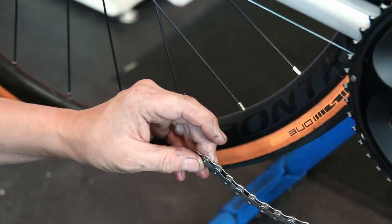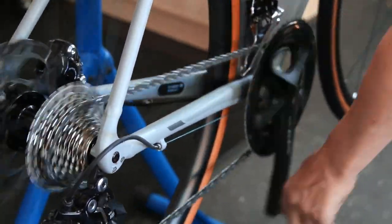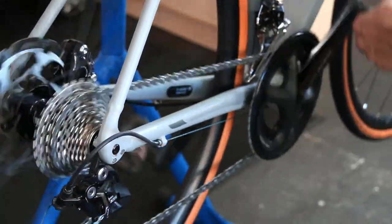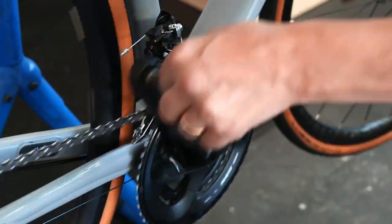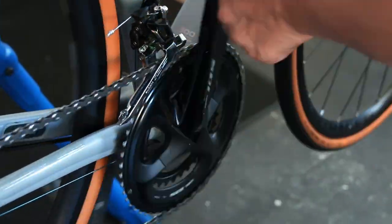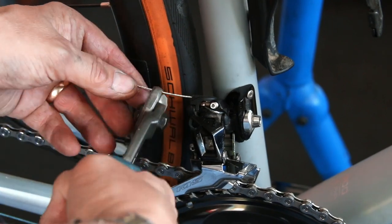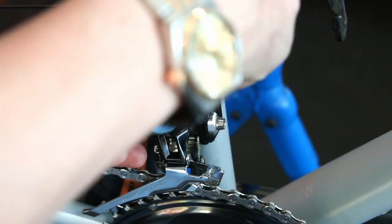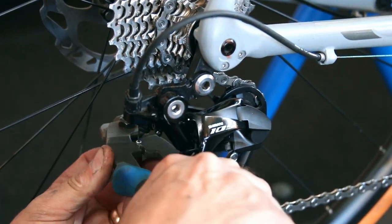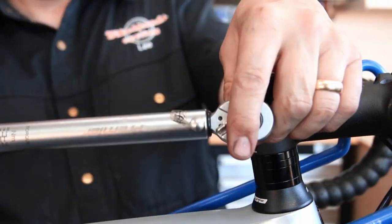Next on goes the chain — sized to the bike with a quick link. Now we begin to adjust the gears: we adjusted the low screw and the B screw, which made a perfect change on the back. Then we had to do quite a bit of adjustment on the front derailleur — it was hanging before going into the large ring. We also shortened that cable end, which was way too long and would have caught your shoes and pedal arm.